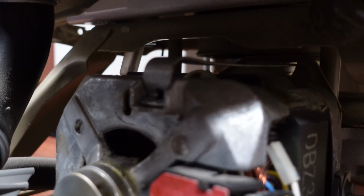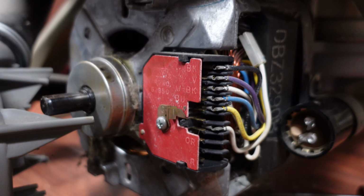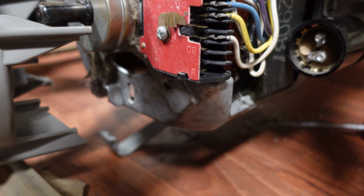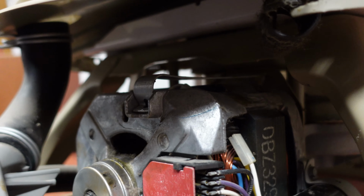So these bottom clips are the same as the water pump clips. You stick them into that triangle and then twist 90 degrees and they lock in place and they attach to the front of the motor here, which is now officially in. And we'll just get the bottom and then do up the screws.